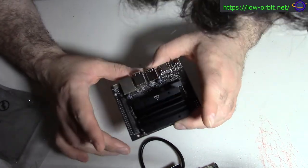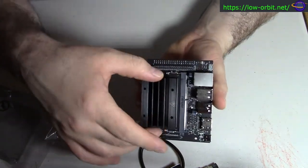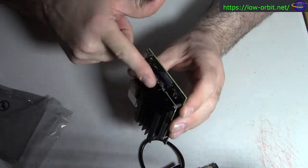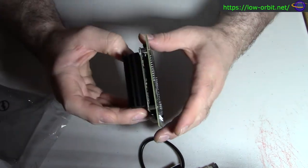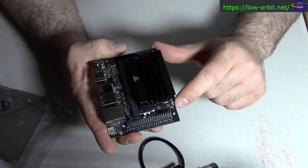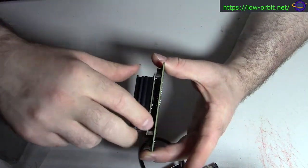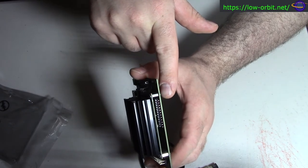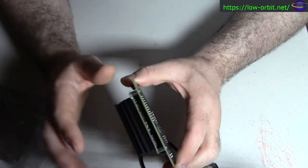The main CPU has a pretty good-sized heat sink on it, and I'm guessing it covers the GPU as well. This is actually a separate riser card — it sits off the main board, which is kind of interesting. So this is basically two separate boards stuck together, screwed in. There are screws here, here, and here, and it basically slides out almost like a stick of RAM. The top board with the big heat sink has a slot where you slide your SD card in. Hidden underneath, there are some additional pins you can connect wires to or solder to.